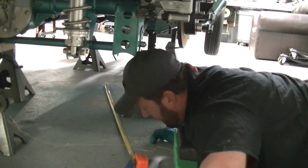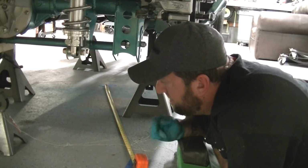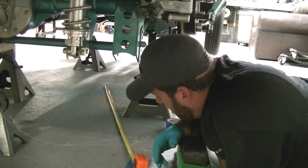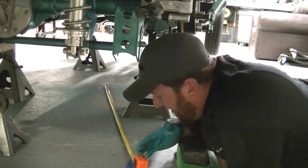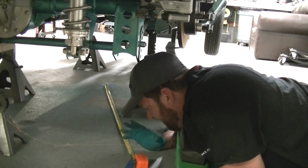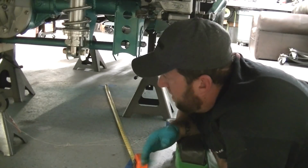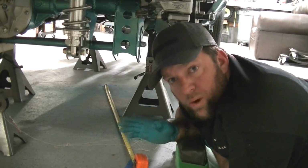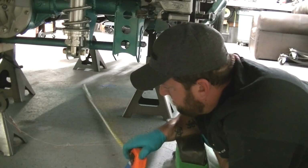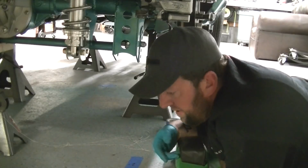Alright, just like that. I was actually a little off on the rear end. Now that it's settled, I didn't really tighten down any of my jam nuts on the lowers last time, so it might have moved a touch, but I ended up with just about 54.5. You know, 54 and 5/8. So it's right there. I'm within a 1/16 on both sides, so that works out well. So now your rear end is square in the body. Great. Cool. It's fairly simple to do that.